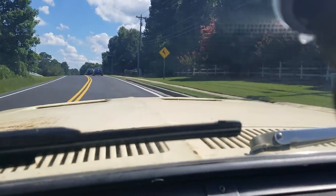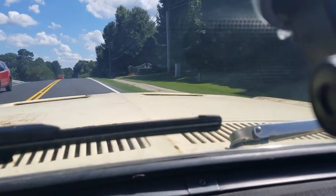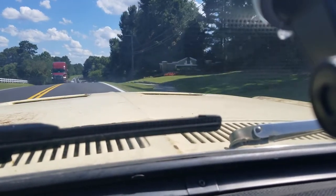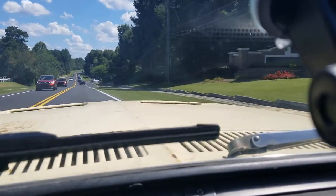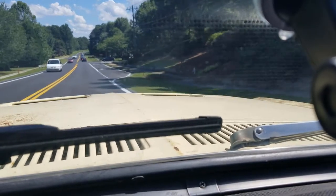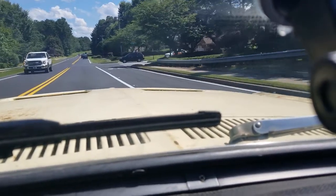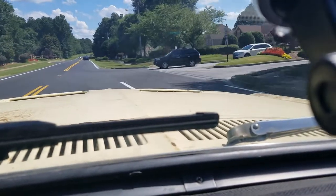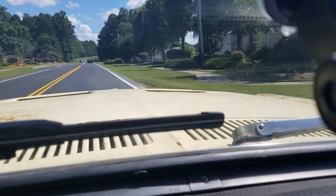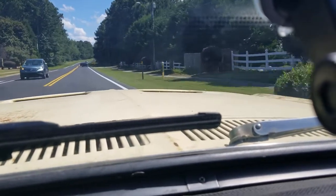Steering is so much better since we did the rebuild on the front end. Definitely tell the difference. It's still got play in it. Still think the steering box probably needs to be either rebuilt or replaced. I'm toying with going with Borgeson power assist steering on that. But we'll see. We got other things we need to figure out first. Still have to figure out the transmission leak.